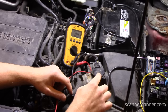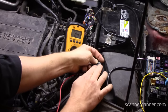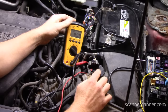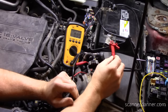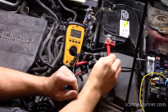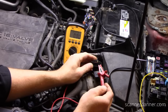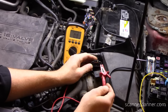There is an internal intake air temperature sensor inside this MAF that when I unplug it, I should have on at least one of these five wires a 5-volt reference. My multimeter is already connected to battery ground. Touch on battery positive just to make sure we have voltage — 12.9 volts. We had a charger on here, so voltage is a little bit high from that. I'm just running down the line checking for my reference — not stuffing a T-pin in here, don't want to spread any terminals, just doing a very light touch on these pins.